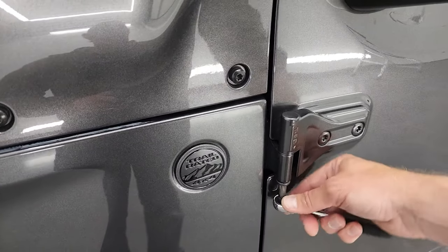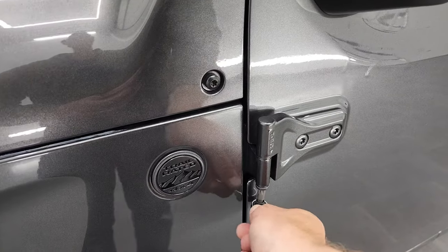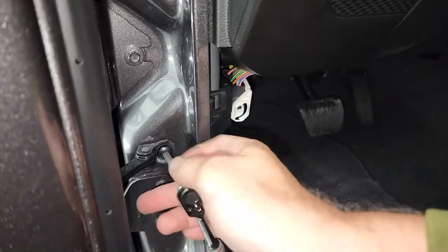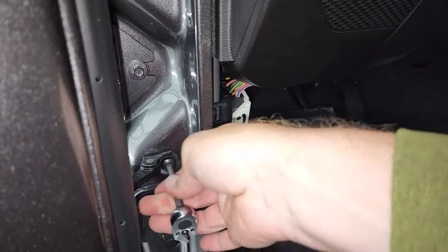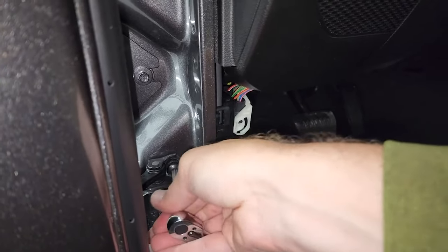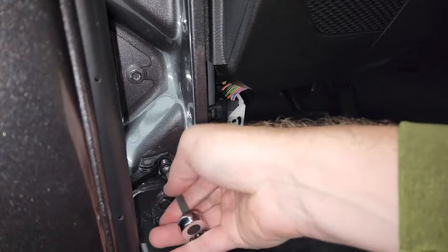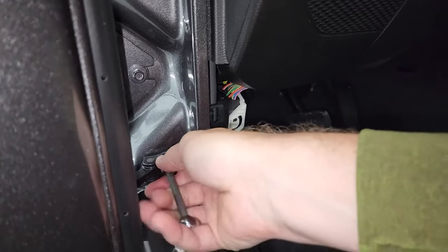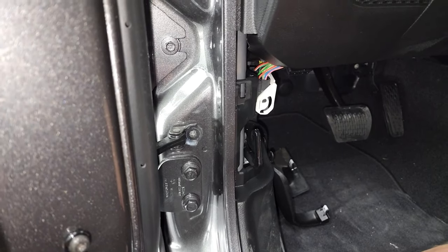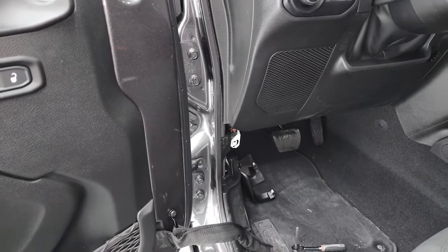Be careful you don't hit the paint or dent the vehicle, because you want your Gladiator to look good. You're going to want your Torx 50 for the hinge bolts — just start loosening them up. Then grab your Torx 40 and that comes out real nice and easy. Now it's very important that this brace piece right here stays out, otherwise you will have a hard time getting it to attach when you put your doors back on. So at this point do not close your door — it is ready to come off and needs to come off open.